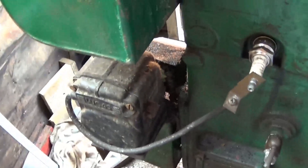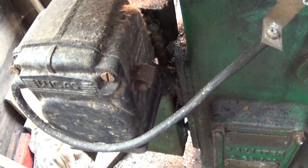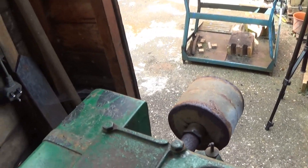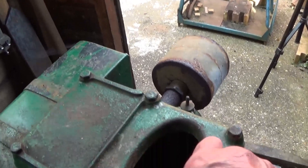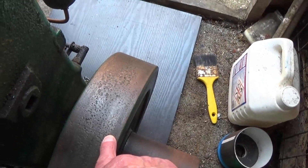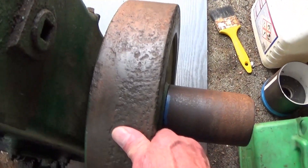I set the points on this engine — there's a video where I fitted a new condenser. When I got it, it was running alright. But on an older engine, this is the important bit: you can static time it to start, use a timing light if you like, but when it's running you want to advance it until it knocks under load, then back it off a fraction. Because when that timing chain is stretched, the marks are useless. Your timing mark — about 15 degrees before TDC — could be anywhere, maybe at 30 degrees. It varies.